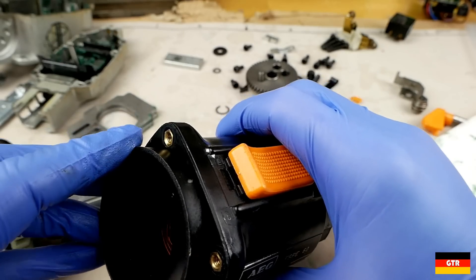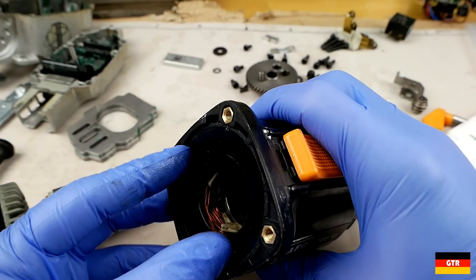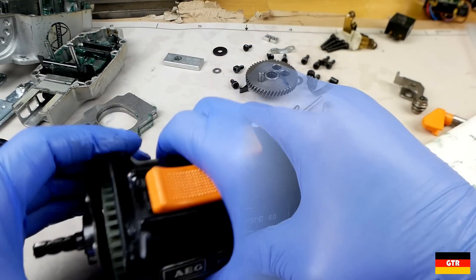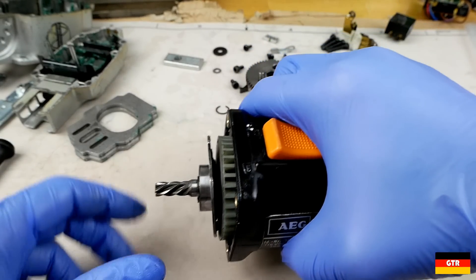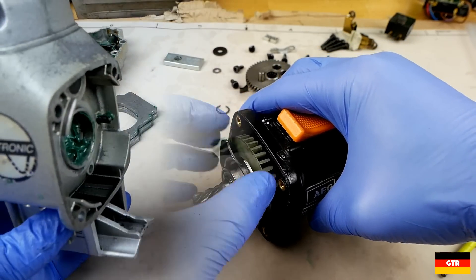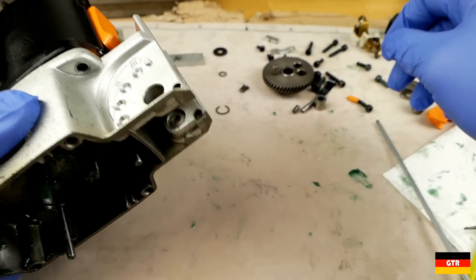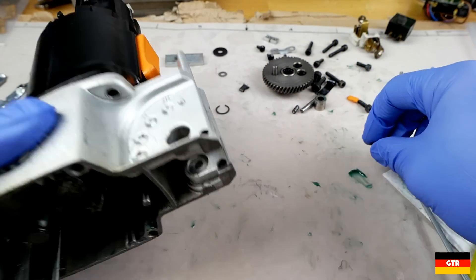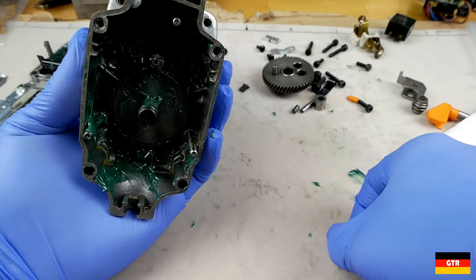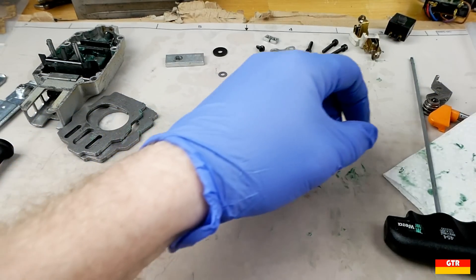Pop in the air diverter and then the armature assembly. That's kind of an interesting design — this little plate actually pulls it forward, so it's going to be a pain to line up, but I think I can do it. Got it in there. Now we've got a couple of screws down in there that go through the case, so we'll go ahead and put those in now. Now we can finally move back to where we were before.